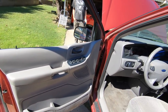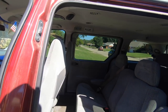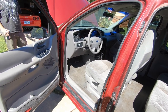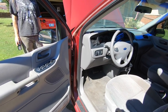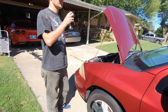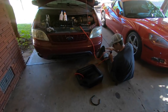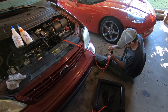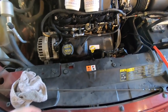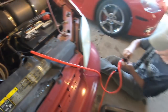This one was already pretty much clean, just needed to wipe down a few things. We'll throw some tire shine on it. But wait - we still need to pump the transmission, try to get a couple of quarts out. Here's what it looks like when you pump transmission fluid out of a vehicle. You can do this right through the dipstick hole. We've got this great pump from Harbor Freight - about nine bucks. Pumping the transmission fluid this way is a bit difficult because you're going from a big hose down to a tiny one, but we've pumped about three or four quarts out so far.